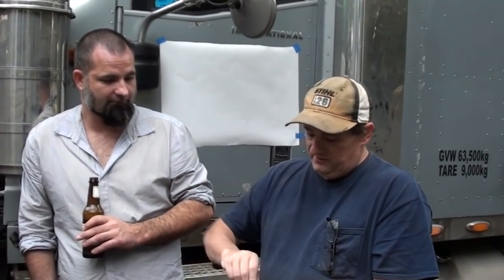So if you've got a worn out turbo or if there's something hanging up inside, you can actually see the amperage as you move it, whether the amperage goes up or down or spikes. So it's kind of cool. And I want to make a little YouTube video of it because he said he's been having trouble with his turbo, which he's not sure about. And lo and behold, we've discovered that his turbo is actually a little bit messed up.